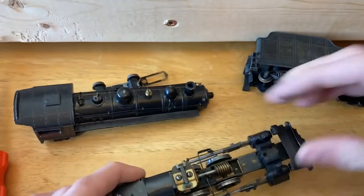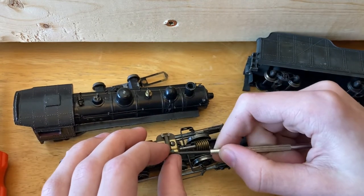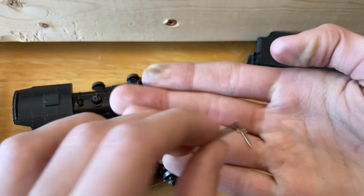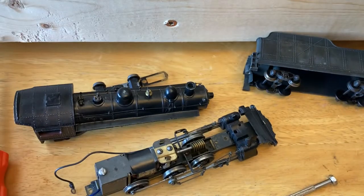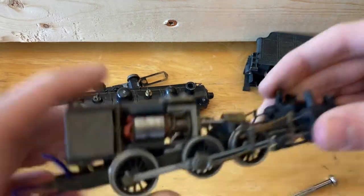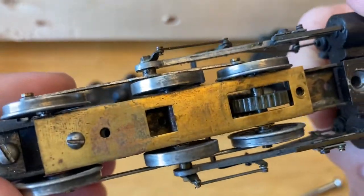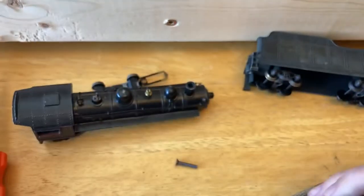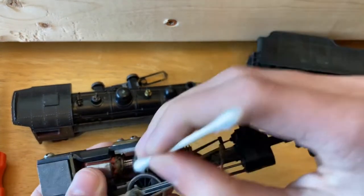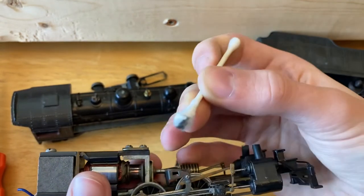You can see the chassis we are working with is a five-pole motor. It seems to be fairly dirty — hands and fingers getting dirty here. It seems to be moving pretty freely, a little oily, but it should be that way. I will take off the brushes here. Set this little contraption to hold the brushes in. The brushes are right there, and let's take a look at our commutator, which I feel like seems to be the main root of this problem.